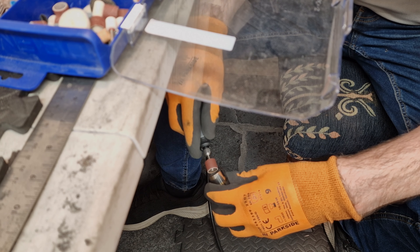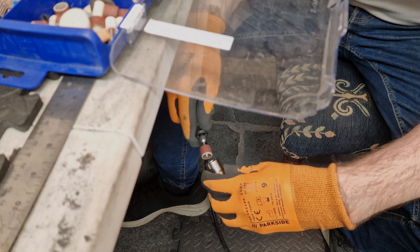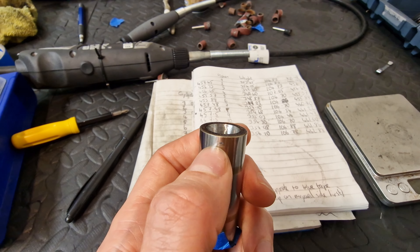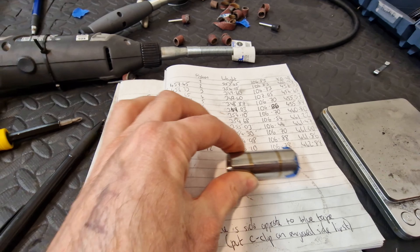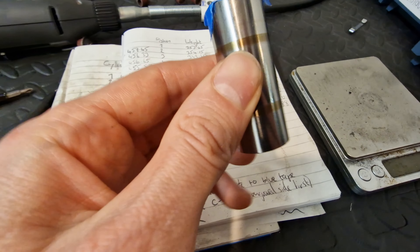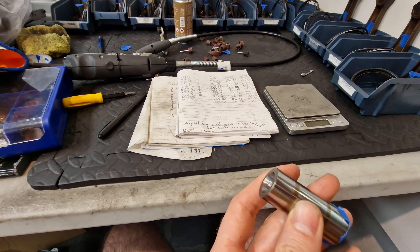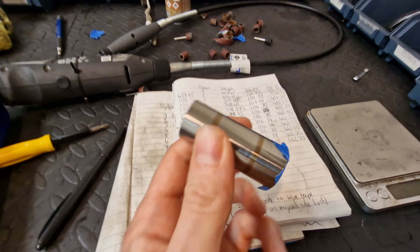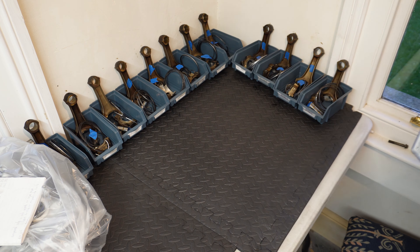I'm just going to be happier knowing all these pistons are perfectly balanced in terms of weight. Once the pistons come back from the Cerakote coating, everything is ready to be assembled and put back together. Just to show you the actual pin - I started off with a chamfer on the outside, the top 10 mil or so, using the larger sanding drum, then moved to the smaller one for the inside so it tapers towards the inside right up to around the 50% point. It takes a very long time - I could have given these to the machine shop and put them on a lathe, but that would have cost even more money. This is costing me an absolute fortune to rectify this horrible mistake, so I decided to just do it myself. Nearly done - 45 minutes and I'll have the last one finished.